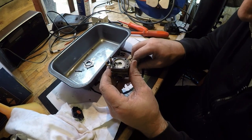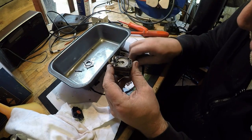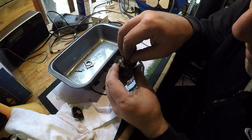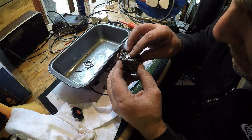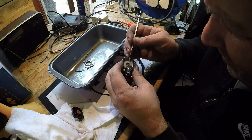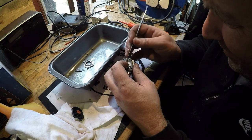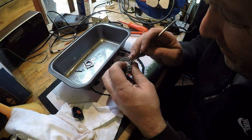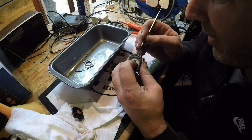Then we'll get your needle, sit him in the hole just down in there. He lives in there. And then this little tiny assembly here that sits on top of the spring and through the needle as well. So put it through the needle first and then lift it up so you can get that spring underneath it. Now very careful because you don't want this spring to shoot off. It's just a bit fiddly. I might have to retract the spring back out. Sit in its little home, and then just push him down. Like so. That's got him. Just double check. Yeah, that's got him.